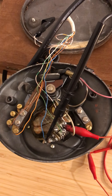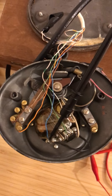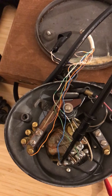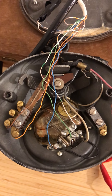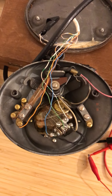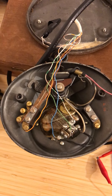The newer dial phones work the same way. There are a couple of terminals connected together. Some phones are normally disconnected and when it passes through the pulses it becomes connected, so you'd wire it a little differently. On the 1970s version there are pins to indicate the dial is not in the home position, pins that generate the pulse, and of course the on-hook switch.